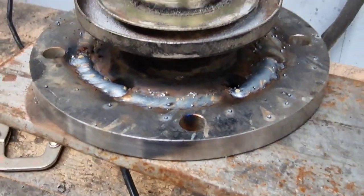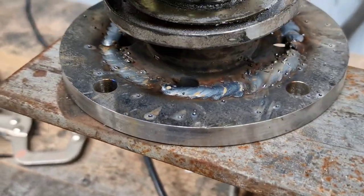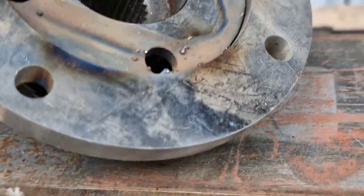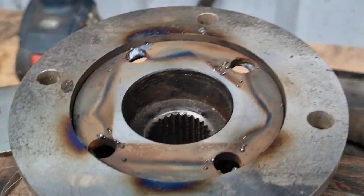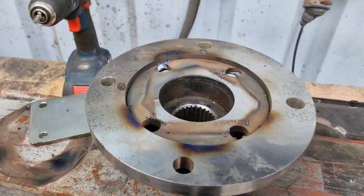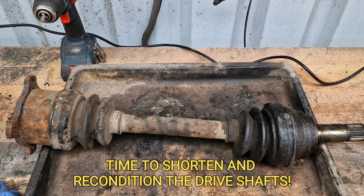So that's one ring done. I broke the welds up into sections so that I wasn't going to introduce any ring warpage on the first side. You can see that it's pretty okay — just a little bit of cleanup needed.